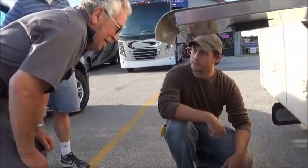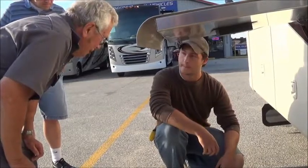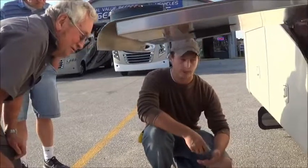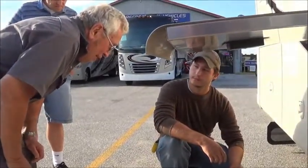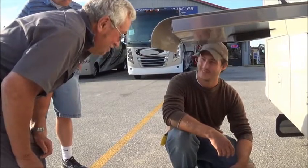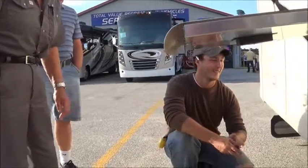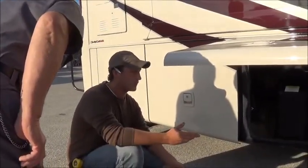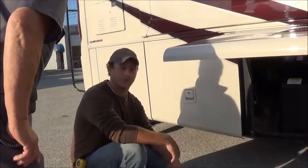I had some problems at a campground in Stony Lake. I went in there and didn't have a lot of fuel, and wasn't planning on running my generator. They couldn't get me hooked up to electricity, so I had to run my generator all night. The next day I went to the dump station, dumped it, got back in, went to start the RV — it wouldn't start. It was empty. I had just enough to get to the dump station. So your actual Freightliner manual inside will explain the system more. Just keep some DEF on you so you don't ever run out. You won't have to fill this every time you add fuel — this will last a lot longer than your fuel itself.